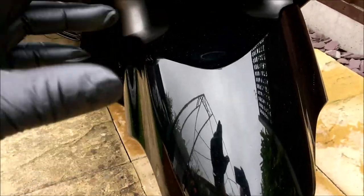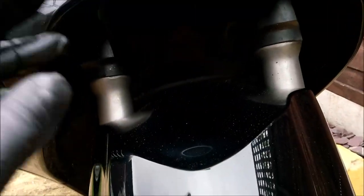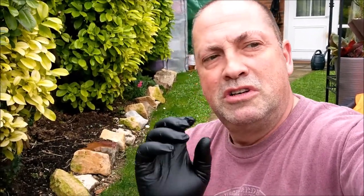But what I'm going to be doing is getting all this Tupperware off, everything, front wheel off, out, discs, calipers, get them off, taken apart, get the seals put in, the wheel bearings put in, and more importantly, get these forks out and empty the oil out. And I guarantee you that oil in those forks will look just like the oil that came out of that gearbox at the back there, that differential. It's going to be shitty green with a hint of snot, bubbles. It's just going to be water. It's going to be all kinds of crap. I just know it because of the way the suspension feels, you can feel it.